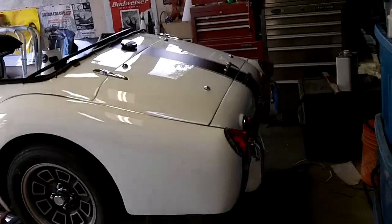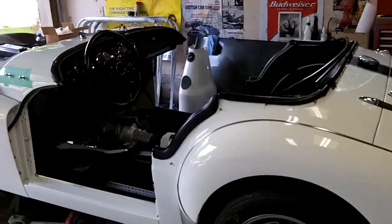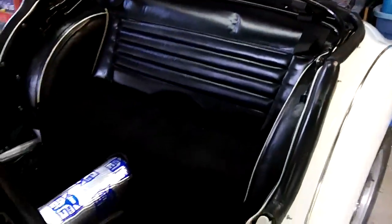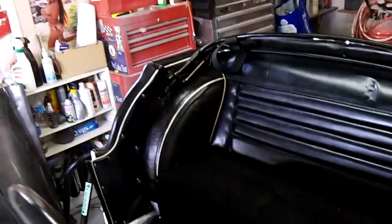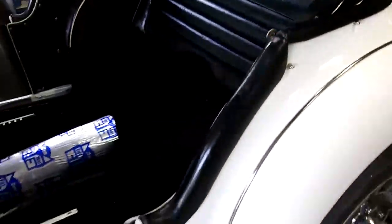Hey guys, Tosh coming at you — it's just coming up to 6 o'clock, just about dinner time. Quick update: we've pretty much got the rear interior of the car in now. It's a used interior from the parts car so there are a few little blemishes here and there, but it cleaned up not too badly. The wheel arch covers are now glued in and they look okay. The only thing I need to do is fix the back piece at the bottom — there are a couple of clips I've got to find to bring that panel in. I've also got the hood sticks on for the convertible top, all the paneling in along the sides, and all the capping along the back and sides.